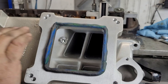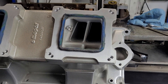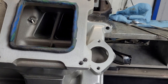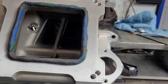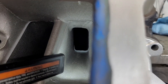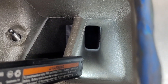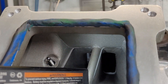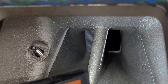It would have been better if we had some carbs on it, but if we put two 600 CFM carbs on it, we're only going to lose a couple CFM. Please shine down the port so everybody can see the misalignment. I did move it a little bit, and we did try a small adjustment. But you can see a little bit — maybe even a lot — on the bottom. This is just hanging on the bolts on the head. There's a little bit on the side, nothing on the top, but that bottom is a big wall.